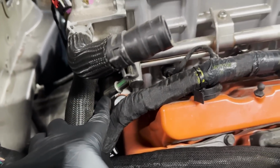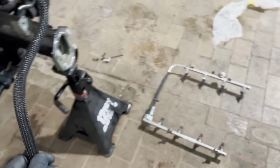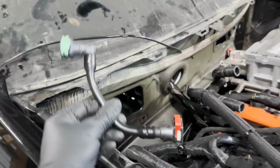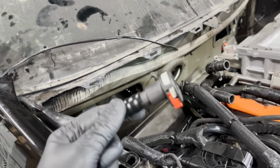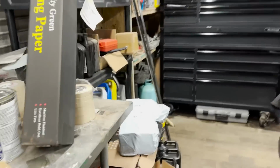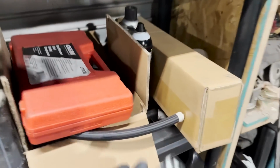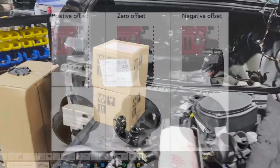So here is the fuel hose. The fuel hose, we made everything work OEM off a Red Eye, but the problem that we're having is the fuel line off the Trackhawk is too long. So see how long that is? That is gonna have a bend in it. It's gonna cause some issues down the line. And then the charger line, that's a charger line that I ordered from the dealer, it has the wrong curve. So when I plug it in, it didn't want to stretch how I wanted it to stretch. So what we're gonna do is we're gonna use the connectors off that line and make a custom line using the fitting that I have. So we're gonna cut those off, put them on that custom line that I have, measure it how I want to measure it, and then we'll plug it right in.